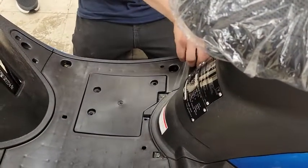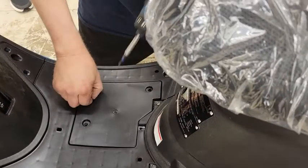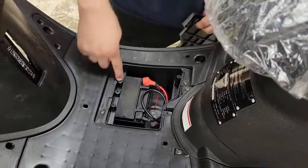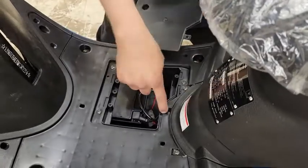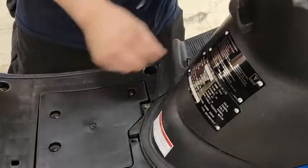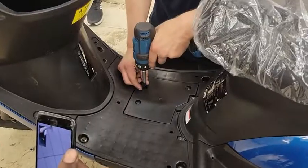I'm going to hold that down and run it so my terminals are positioned so I can easily move these. I'll take this bottom wire and bend it down and this one slightly up, then take this insulator and slide it over this terminal. Because these are square they should cover that terminal as well — if they weren't placed on there customers would think something's wrong with their vehicle right off the bat, so it's generally a good idea to put them on. I'll go back down with the four screws, being careful that you're actually going into the holes underneath because these don't always line up properly. Once you're sure your alignments are good you can take them all the way to the bottom — don't over-torque, don't over-tighten.